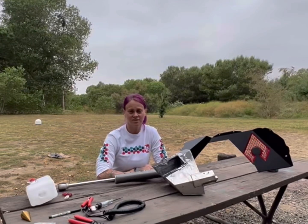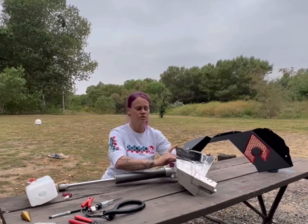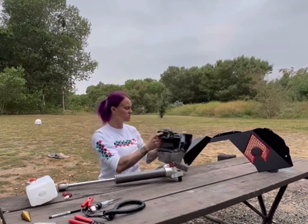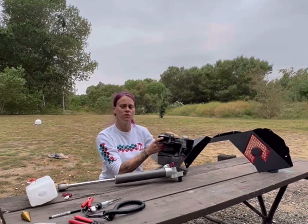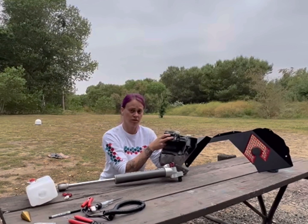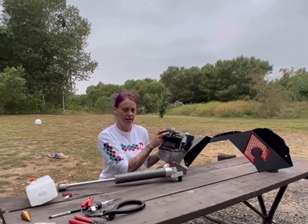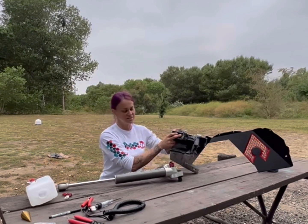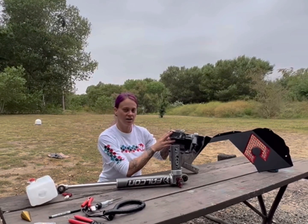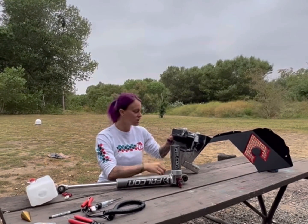Like everything else on the Diesel Gladiator, the washer fluid tank was moved. So we originally had the Artec inner fenders, we wanted to keep those, but the original washer fluid tank didn't work with them. So we decided to go with the moto-built washer fluid tank, and it of course didn't work with our Falcon shocks. So we had to modify the washer fluid tank in order to fit the Falcon shocks.